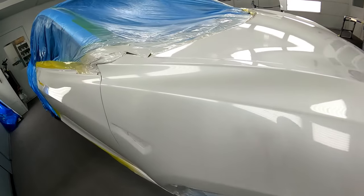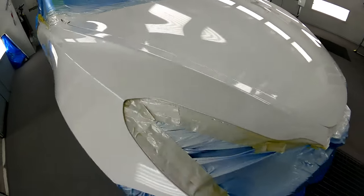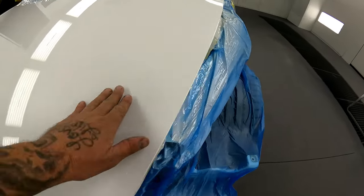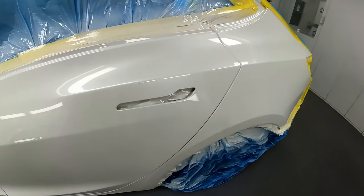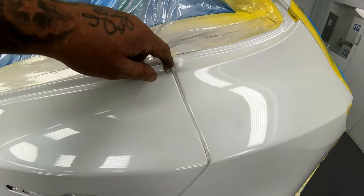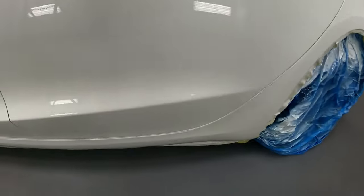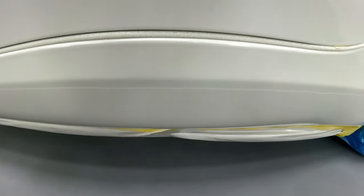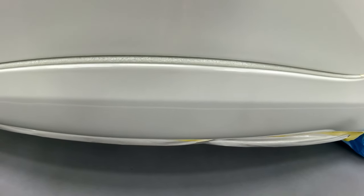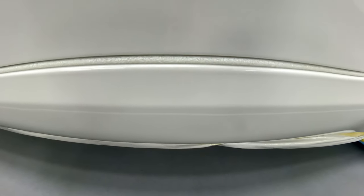The job is all baked and you can see it's still got a beautiful shine with that combination. We're going to unmask it and check where we tried out that foam and see how nice of an edge it'll leave compared to the fold tape. I'm not sure how it's going to be because you guys are doing this for the first time with me here trying it out. But you can see it actually leaves a little bit of room in between the door and the foam, and that's what I like about it so far. The bigger foam usually wants to get stuck to things and doesn't work very good, so let me unbag this one and we'll check out this jam.